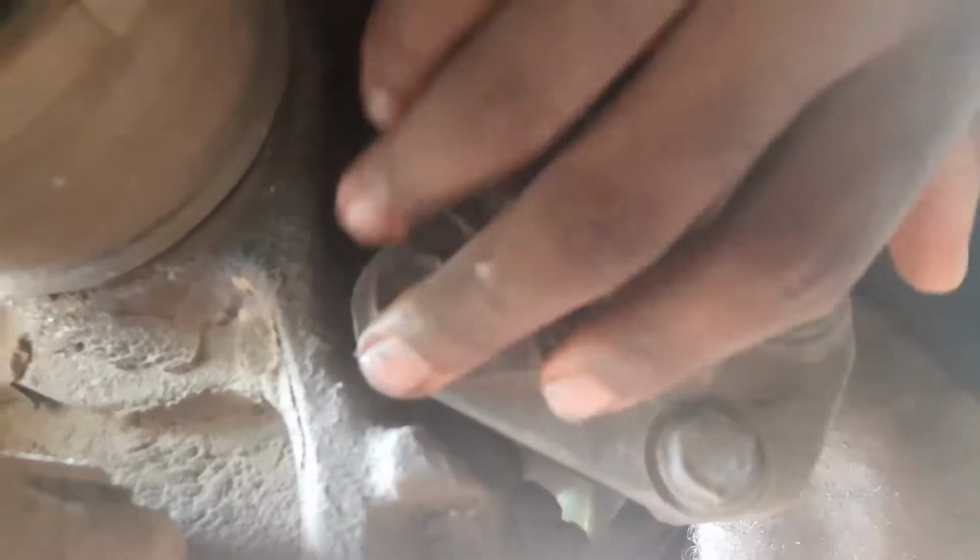We're going to take off one 17 millimeter. Where is it? Right here, right there. This 17 millimeter, and then the 17 millimeter below, which is this one right here that I am touching, to take off the brake caliper. Okay, so that's what we're gonna do next, and we'll just try and hang this somewhere.